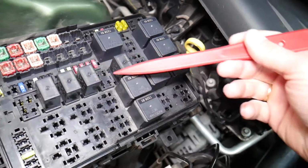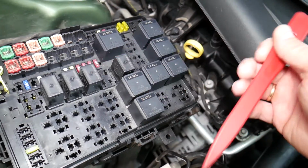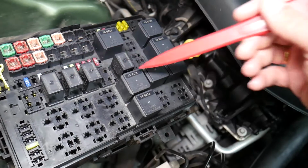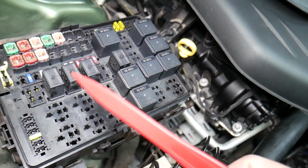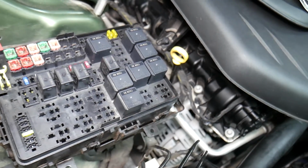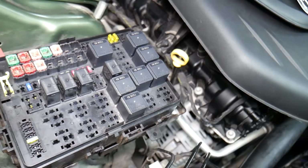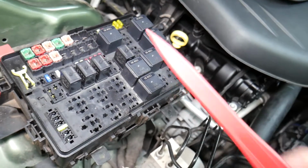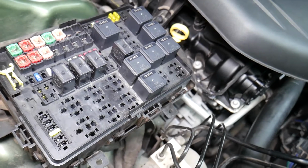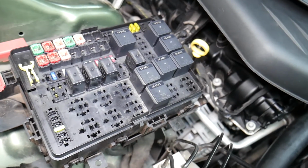The same thing goes for relays. Some of those could be really expensive on cars, so we'll put a link in the description below on how you can test relays. For certain fuses, it's important to disconnect the car battery when removing them, otherwise you can burn the electronics. For instance, when working on airbag fuses or anything like that, you need to wait at least 1 hour after disconnecting the car battery. And if you're not qualified and certified to work on the airbag system, I would never recommend doing that.